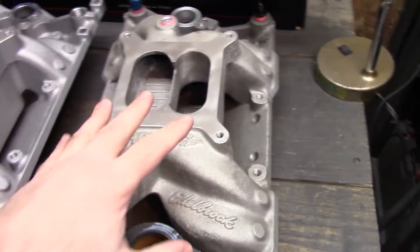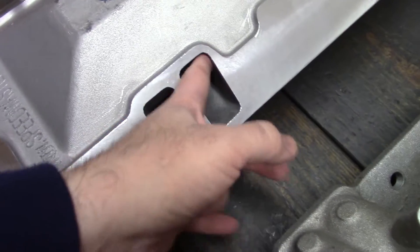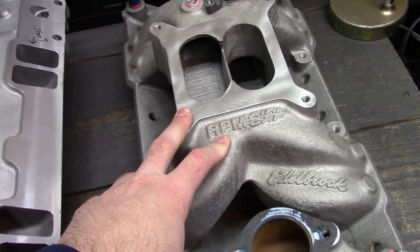I do have one other point about the Edelbrock intakes. I had issues with both of them. I'm not a super fan of Edelbrock — I like the Dart SHP, the EPS is fine. I've heard Edelbrock has fixed some of their casting issues. But the RPM Air Gaps I had were really rough. Looking at the overall casting inside, down in the runners — defects wise — the two Eddies I had, which I bought more than a decade ago, were comparable to the Speedmaster.